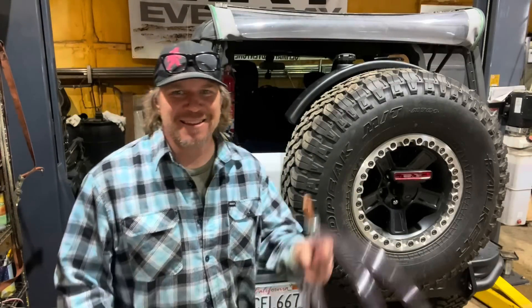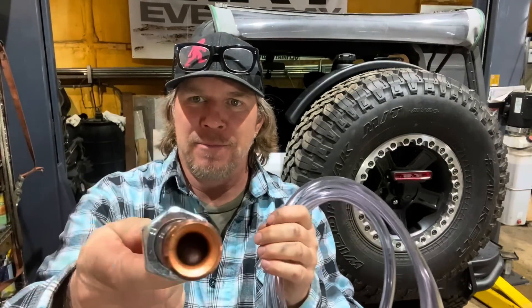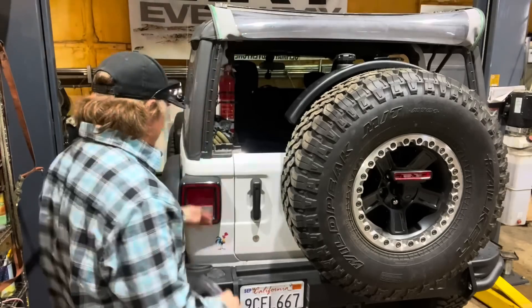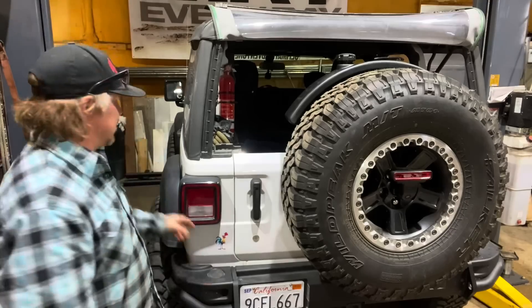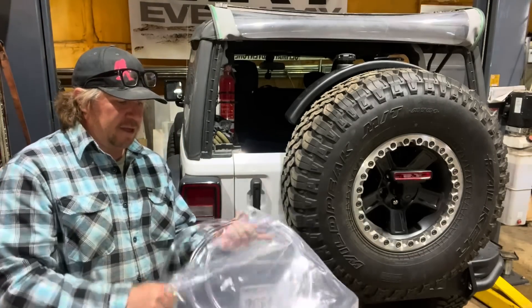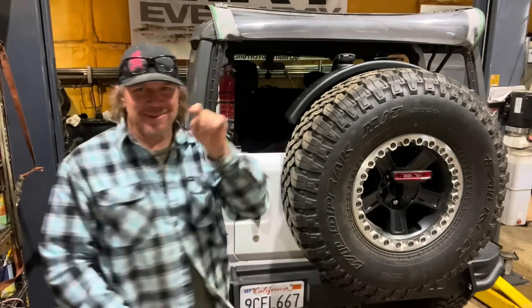One more thing — this is the shaky siphon. You use it to pump gas out of the fuel caddy: stick it down inside and shake it, and a little marble in the copper piece pumps gas out. You need this because you can't just remove the caddy and dump it. Fill the caddy with gas, stick the siphon in, shake it, then put the other end in the Jeep's gas filler to pump your extra 10 gallons into the tank. Keep it in a Ziploc bag because it'll smell like gas.